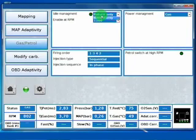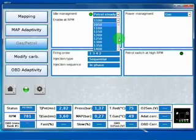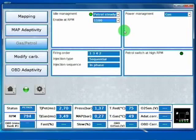And there is even the possibility to make petrol steady. So in this case, we will always have petrol on idle. As you see here, we are on petrol because the LED is lit. But when I get over this threshold, okay, the LED turns off and we are on gas. And when we get down from this threshold, we will return to petrol. Some cars have some problem with stability on idle, and so we need to make this kind of adjustment. You can select, obviously, at what RPM this function works. Okay, we'll go back to gas.